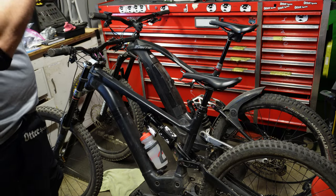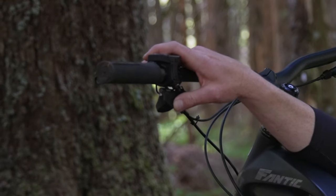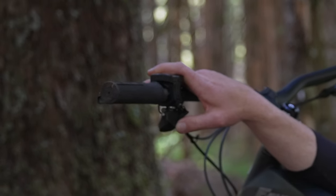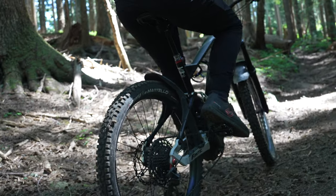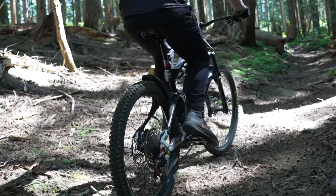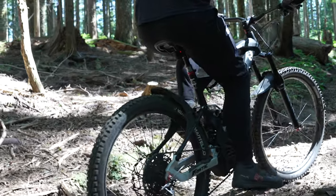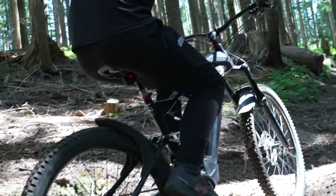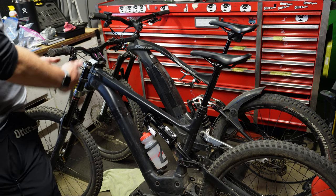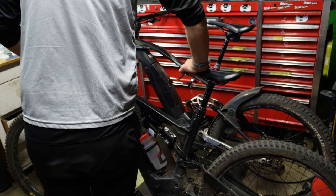It's been a mixed experience with the RockShox wireless dropper post. The lever requires like no force to press, so if you had small weak hands or an injury, the wireless dropper post is going to be a better option. You can also micro-tune the seat height many times while you're climbing. With the cheap dropper post, it has a long throw on the lever, so it's a lot harder to micro-tune it.